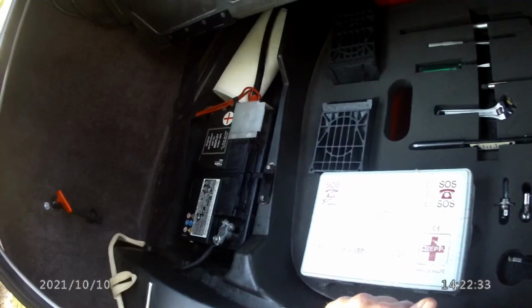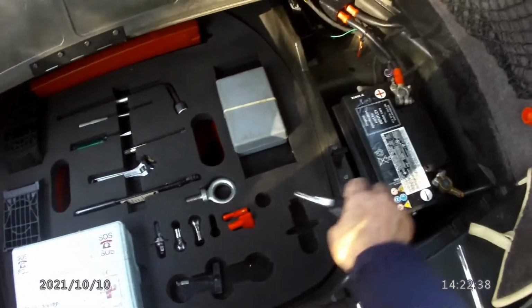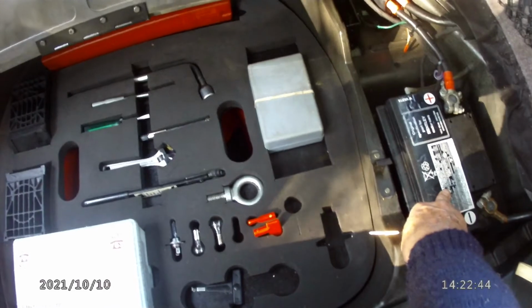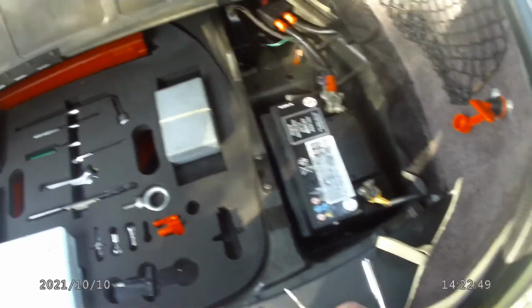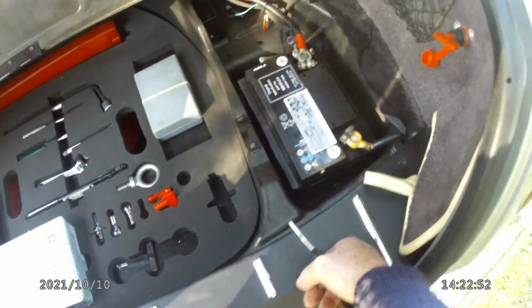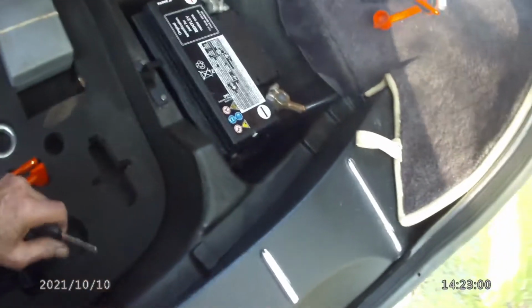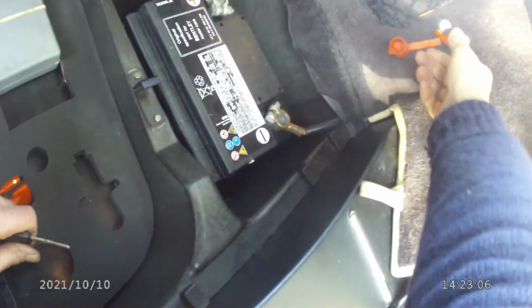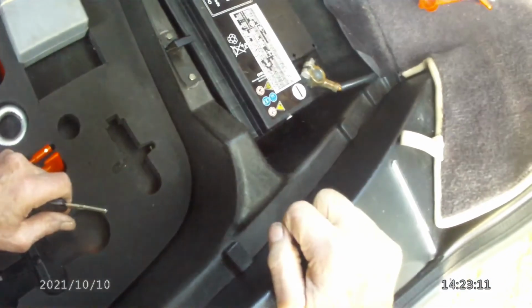And it was exactly the same with my Cloud. Anyway, two batteries, and if you leave this for any length of time, they can discharge and make starting possibly tricky. So the first thing I did was put in battery isolators. So if I get back here, there's a battery isolator. That's off, that's on. You can take the key out. Once you've got the key out of these things, no one's going to steal it because there is no electronics.